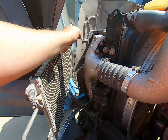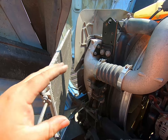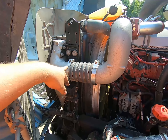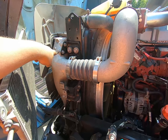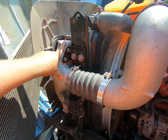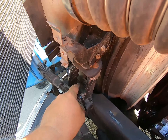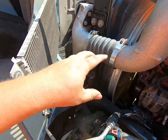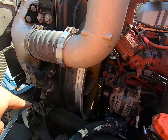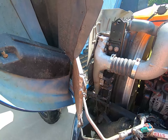This black rubber here we can wait until we get the charge air cooler out — it'll be easier to swap it once it's out of there than working in a tight spot. Next I'm gonna loosen the clamps, pull the hoses on each side, and then we'll be about ready to pull the bolts out. This is a little different than the charger on my Freightliner — there's only bolts in the top, two over here and two on the other side. On the bottom it hooks into a mount — it's more like a hook and then a bolt goes through that hook. I'll show you that on the new one when we get that far.